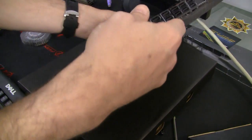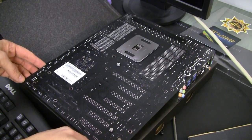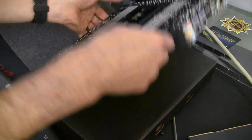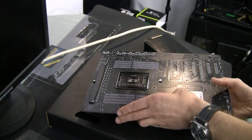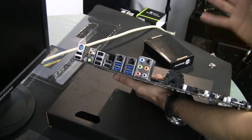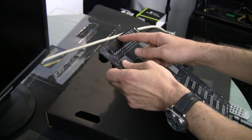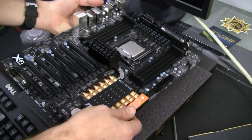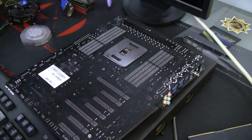Let's flip it over and see. There are three screws that hold this heat sink in place - actually two screws and one screw holds this part - so that will be easy. And for the MOSFETs, we have one screw here and two more screws from the other side. That's a pretty easy task. I think the MOSFET will probably be easier to do at this point, so let me grab my screwdrivers.